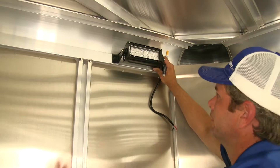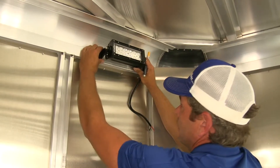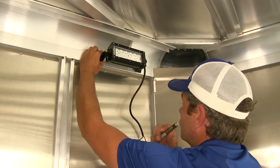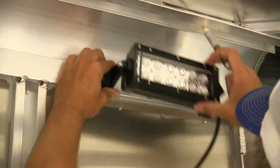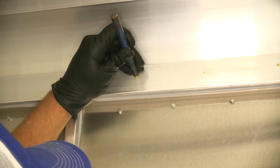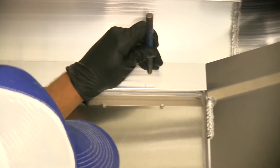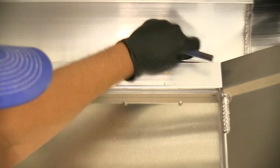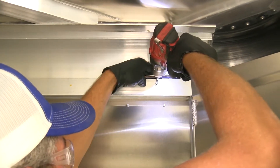We need to find our halfway point, figure out where you want it to mount, split the two sides and center it up for good look quality. On our brackets, we want to get those holes marked, then grab a center punch to mark the center of each of those, and get the two holes drilled out. Be careful — you can see we've got a little wiring back behind ours, so be really careful that you don't damage or drill through that. If you're using the mounting hardware provided, you'll want to use a quarter inch drill bit.